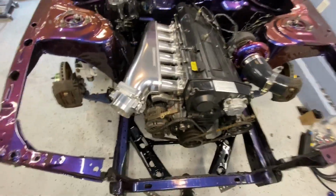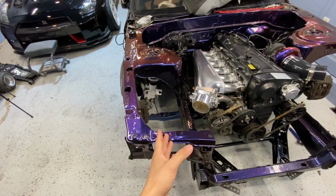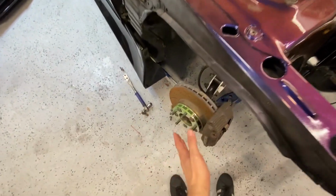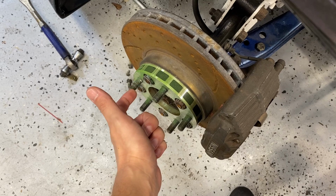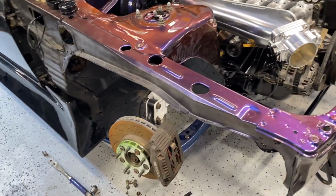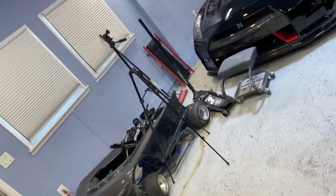Anyways, enough rambling. Let me get to pulling this out, putting this steering shaft back in here, and throwing some tie rods on. I want to put the car on the ground. I've got to pull these spacers off because the back sides of the wheels can't go over these studs and lugs. The other spacers I have set the lug nut in the spacer because they're a little bit shorter, so I have to throw those on too. Basically I just want to have the car back on the ground and do a general eyeball alignment on the steering. And I think that's it, honestly.